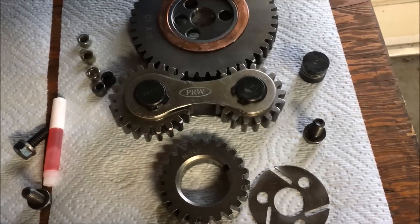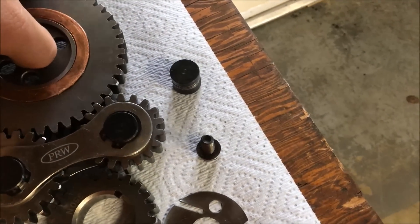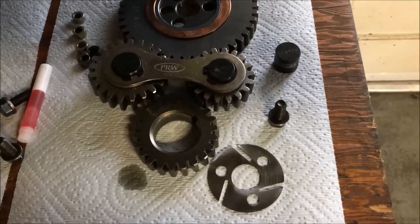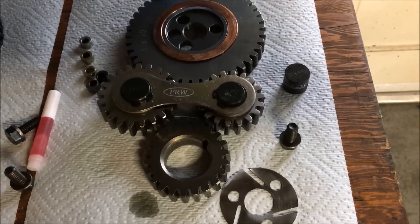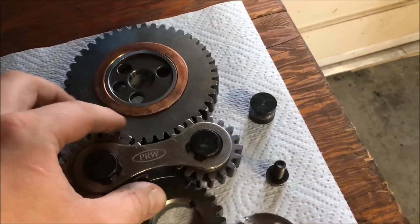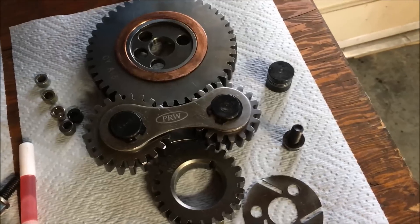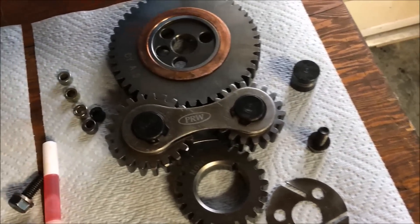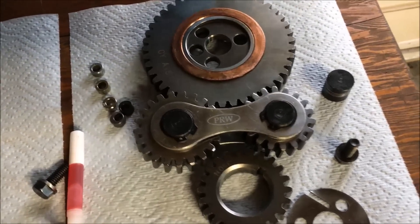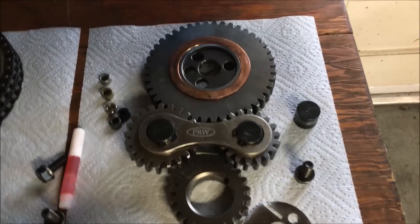What's nice about these is they're accurate as all get-out. It's straight gear drive, so there's no real room for play — it's straight gear-to-gear drive. They last a lot longer and they're really durable, with quick timing adjustments. You can also get them where they're quiet, but like this one here, it's ground with straight grind teeth. What that does is it actually produces a whining noise, so it almost sounds like you've got a blower on your vehicle. You'll hear it spool up like a blower, which is pretty cool — it's just an added sound effect most guys like.